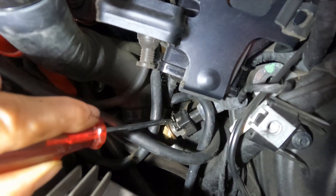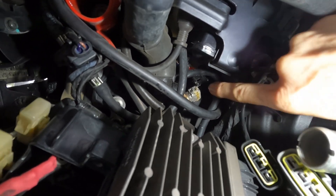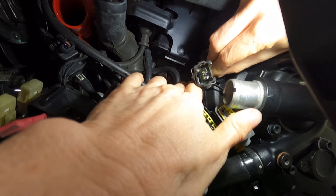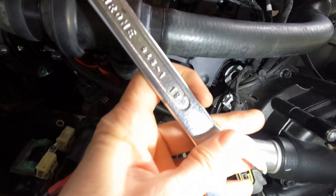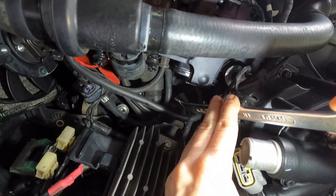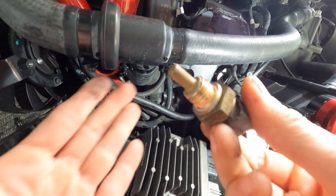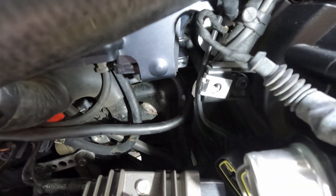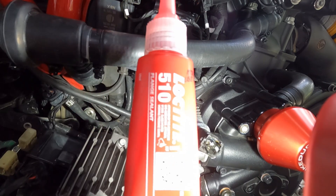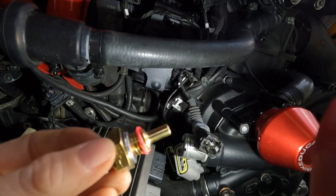Because I couldn't see in there, it took me a bit to work out what clip style was holding the connector to the sensor, but I figured it out and then it came off. I did pull the connector out to check it over and make sure there was still enough grease in there — some kind of electrical connector grease. Also add a 19mm spanner to your tool list to get the sensor out. It looks a bit cruddy in there. The manual said to use flange sealant on the temperature sensor's thread, which is Loctite 510 — and like I said, I couldn't find a reliable source for what to use instead, so I got this massive tube.